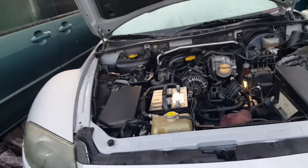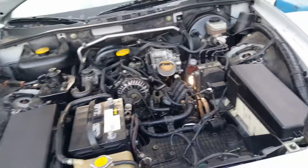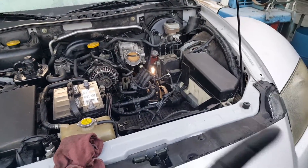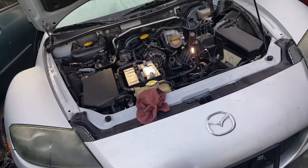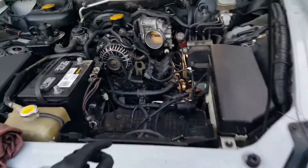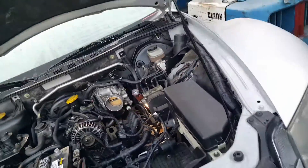Hey, what's going on YouTube — quick tip on how to remove the spark plugs on your Mazda RX8. First thing you're gonna do is lift the car, put a jack stand or a tower under the car, and remove your wheel. You can't get to it from the top because of all the hoses and cables — you're gonna get some cuts, sweat, and bleed. So lift the car and remove the wheel.